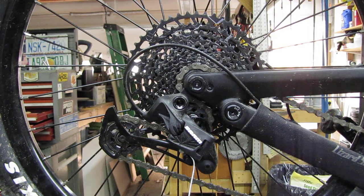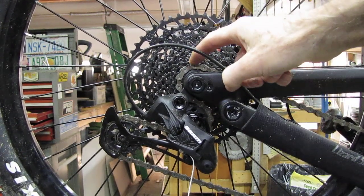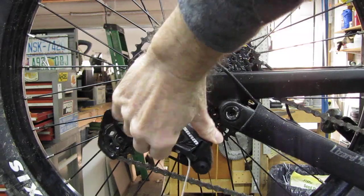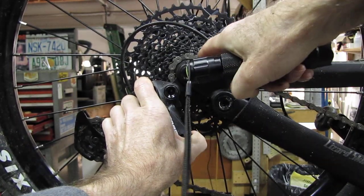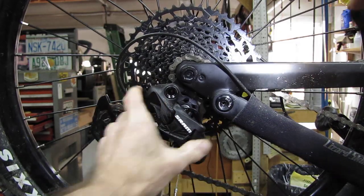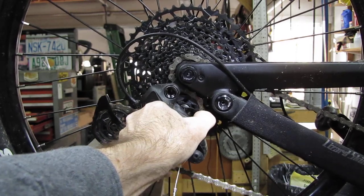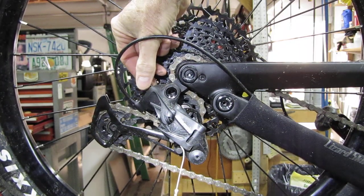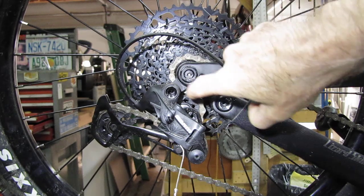I'm here with my Luna X1 trying to figure out why, when the derailleur drops down into the 11-tooth cog, it skipped. I noticed this morning that the chain wrap here was way back. The b-screw right here controls how far forward or back the derailleur sits, and there was enough adjustment to unscrew it and allow the derailleur to come forward more. Now look at how much wrap there is — a lot more wrapped around that little cog.